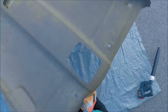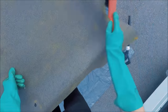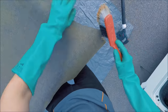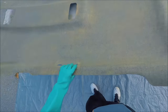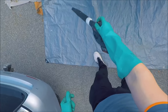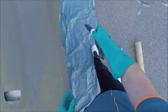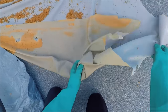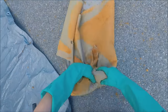You can see here we're dealing with a nice clean surface. But if the customer went out and got a can of glue hoping to hold up their own headlining board, we would have to sit here and sand down all that new glue they've added. That's why I try to educate people not to add glue — it doesn't hold up the headlining boards. You can use quick methods like staples or drawing pins, but ideally the headlining board needs to be removed completely, the old material binned, and the old foam scrubbed off before applying brand new material.